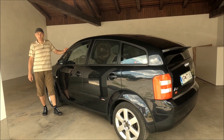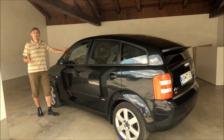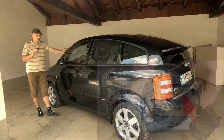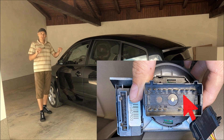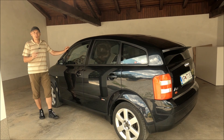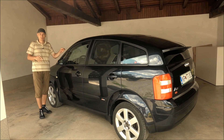Hi, welcome to another video about Audi A2. In this video I will show you how I retrofitted the daytime running lights to the Audi A2, because it is too old and from factory didn't have daytime running lights. But it's good that it was already prepared for them. There is a pin on the light switch that you can use as a daytime running lights pin. I have explained in detail how this works in another video, which I will link in the description.